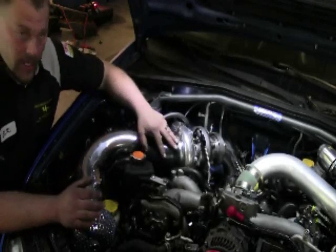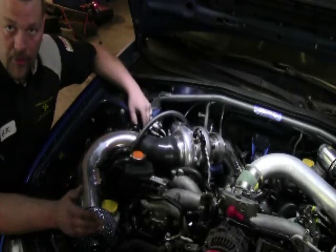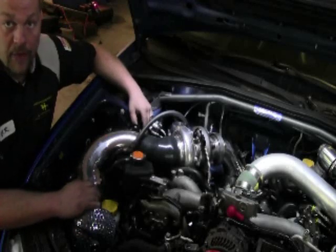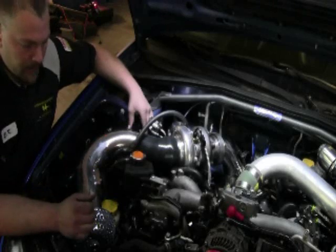With the intake pipe, for the T04BSH turbos — which is the slightly smaller turbo — you have the option of a 2.75 or a 3 inch intake depending on how much power you're trying to make. The larger intake will give you better top-end flow overall, but it'll limit the resolution that the mass air meter has on the small end, meaning idle and light throttle drivability. The smaller one gives better light throttle drivability, whereas the larger one flows more. For the GT35R guys — which is our 6182 turbo — you have the option of the 3 inch or we can bump it up to the 3.5 inch to make complete use of the head flow on the mass air meter.